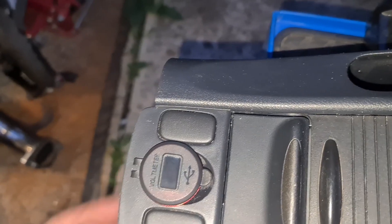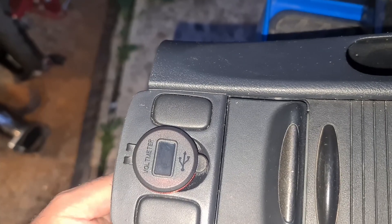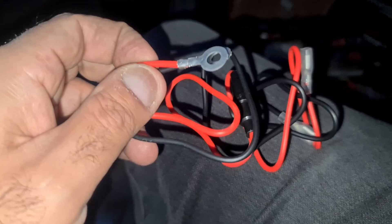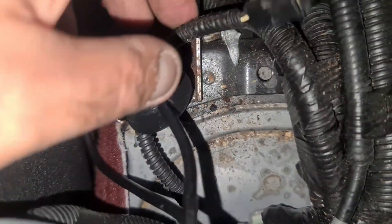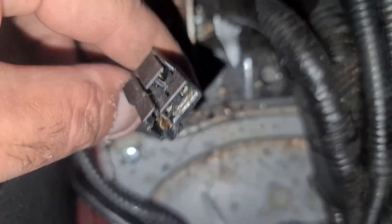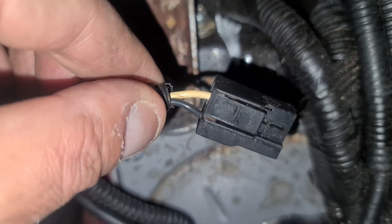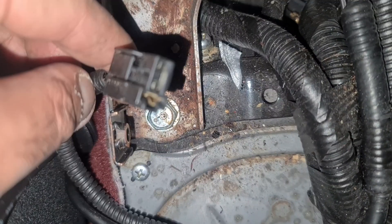Now I've just got to wire it up — it's just a plus and a minus which I'm going to take off the existing cigarette lighter socket. These are the wires that you get with it and it's fused as well which is handy. I'm going to cut these ring terminals off, put some spade connectors on there — male spades — and then plug those into the original lighter plug. I don't like generally cutting stuff on the car so I'm going to plug them in here. Just find out which one's the plus and which one's the earth. I'm presuming the beige colour one's going to be the live but I don't want to presume anything.